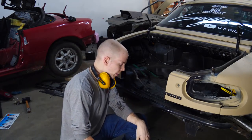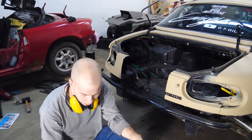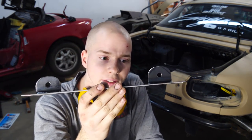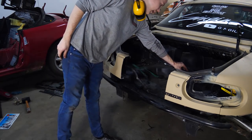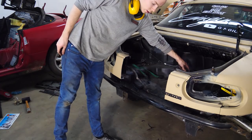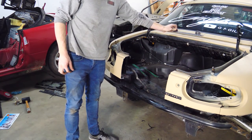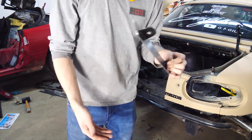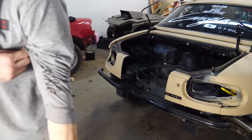The tabs on the bash bar are awesome — they're working really great. They're drying from paint right now. I went ahead and made this bracket, which is going to be where the other side of the ratchet strap bolts to. This will sit inside the trunk and be welded onto that. I was going to put it up top, but then I realized it's kind of ugly up there, and I'd have to paint it and rivet it in, which wouldn't be very safe. So welding it in down there — let's go.